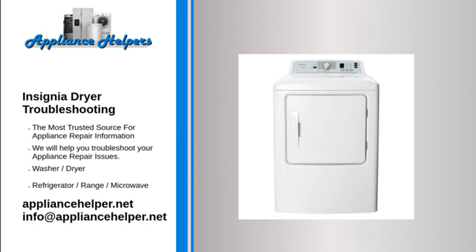Dryer does not heat or does not dry. Your dryer may have moved into the cool-down process of the cycle — this is normal. Select a cycle other than air fluff and a temperature setting that is not no heat. Do not overload your dryer. Depending on the size of your washer, one wash load should equal one dry load. Dry heavy items and lightweight items separately.